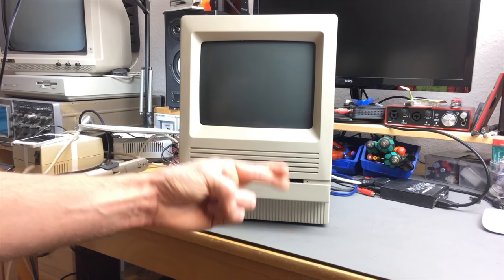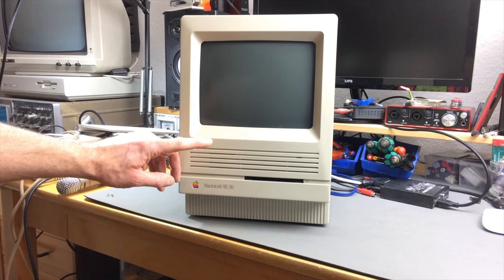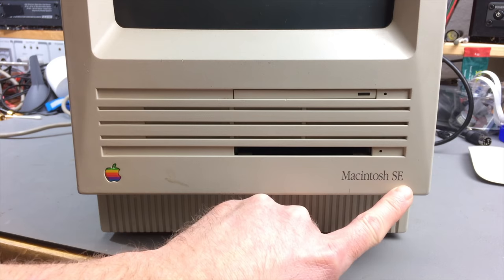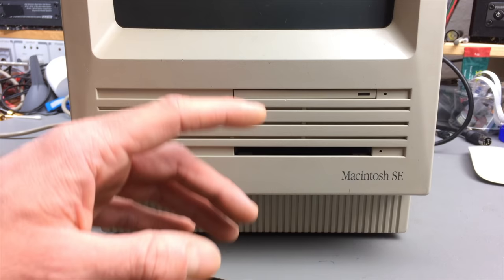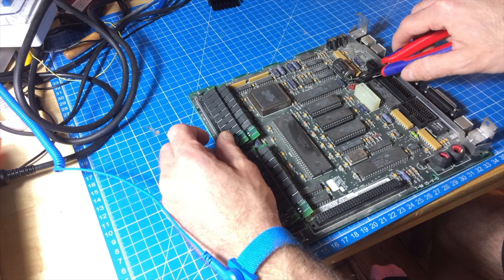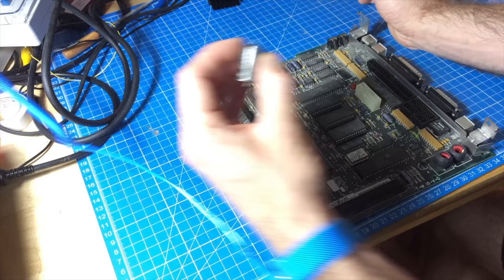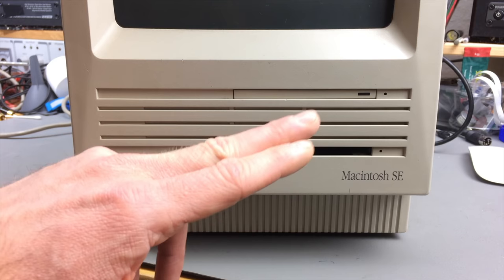I got lucky because it was only that one trace, and it has been working ever since. Another common thing to look for in these — and this goes for the Macintosh SE as well — is a battery on the motherboard that is probably leaking after all those years. You can just remove it. In this case it's soldered to the board, so you have to clip the leads. They can start leaking and corrode the traces on the board. They are needed for storing settings like the internal clock, but these machines will work without a battery, or you can get a replacement. I recommend at least having a look at the board and removing the battery — did that on this one, like on all my classic Macs.